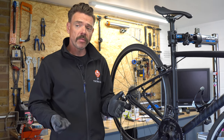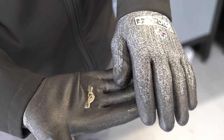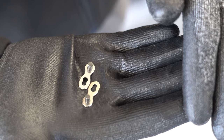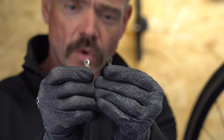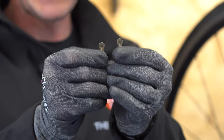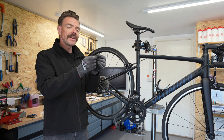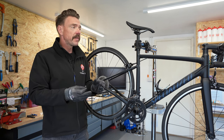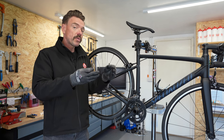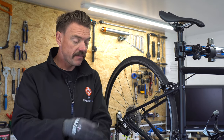In order to deal with this problem, there are things you are going to need to be carrying in your saddlebag before every ride. The first one is a quick link — effectively a small set of chain links which allow you to quickly repair a broken section of chain. Some chains don't come with one in the bag, but you can purchase these separately. Make sure you buy the right type for your chain: if you've got an eight, nine, or ten speed bike, buy the matching speed quick link and keep it in your saddlebag.